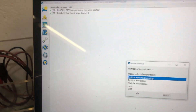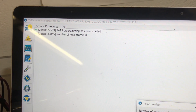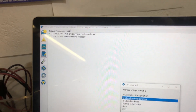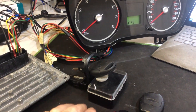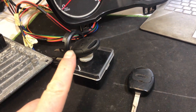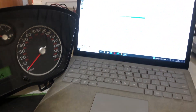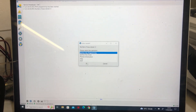We can see on the Focus that we have deleted the keys — no keys stored. The next operation before we can synchronize is to program two keys. You need two keys to do any of these operations. We're going to program the two customer keys to that cluster and see if we can get them in.